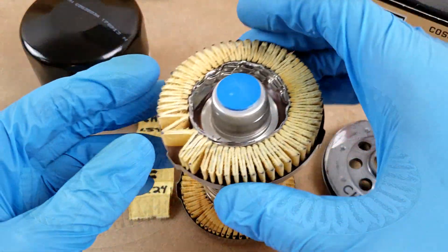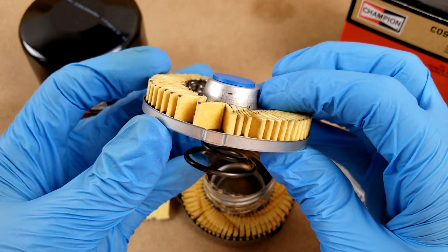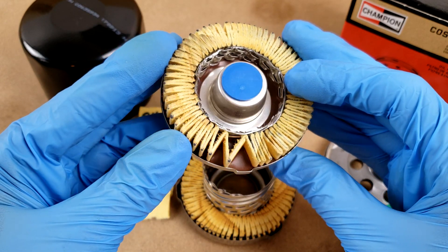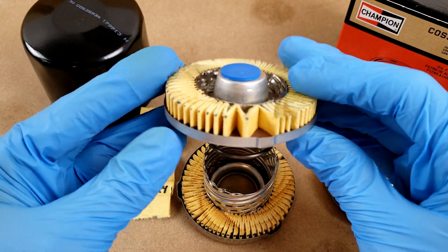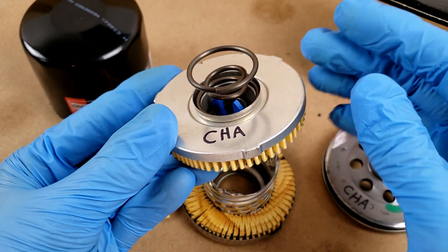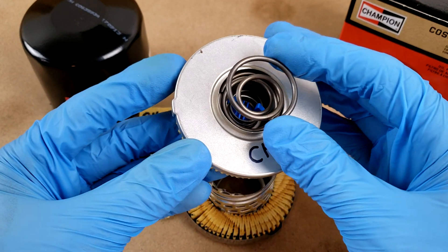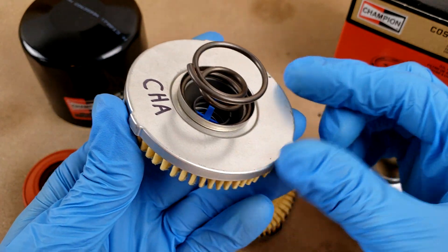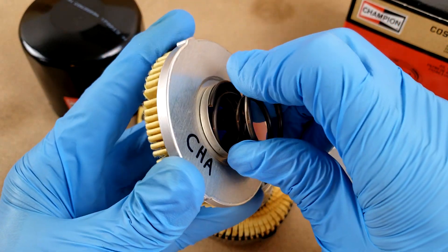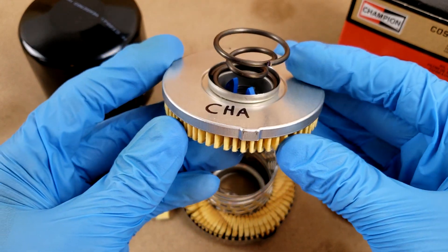The emergency bypass valve has a very rigid support — save for where I nicked it when I was cutting it open — but it's got a very rigid support. The poppet is made from plastic, which is one of the two most common designs, and I'm just impressed with how robust it is. Flipping it over, you can see the coil spring that is meant to push against the inside of the case and hold the cartridge down against the anti-drainback valve. The only notable thing about it is that the bottom is captured pretty tightly inside a track, which may not be necessary but gives you confidence that it's not going to walk off center — a cool little plus.